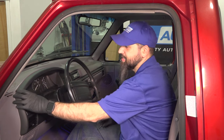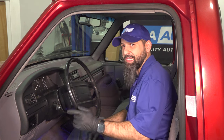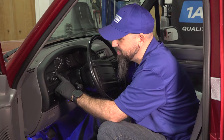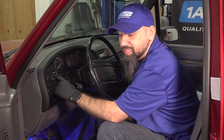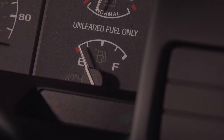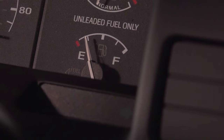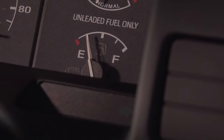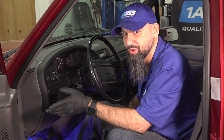So what's the issue? Sometimes your front and rear pumps aren't working correctly — could be the front, could be the rear pump. The first thing to do is flip the switch with the key and ignition on to either front or rear, wait a few seconds, whichever is the opposite. Check your fuel gauge and make sure you actually have fuel in both tanks. If you have fuel in both tanks and it's still not starting on one setting, you may have a pump that's not working correctly.